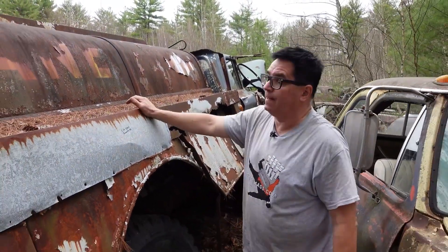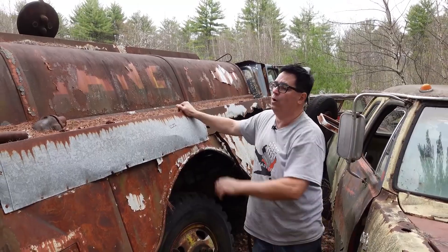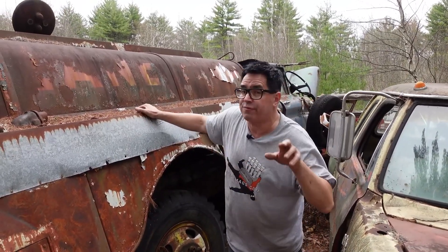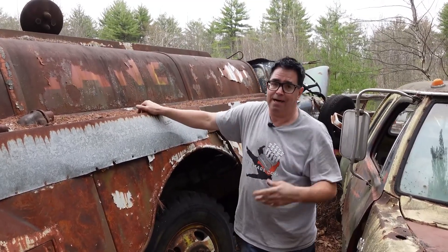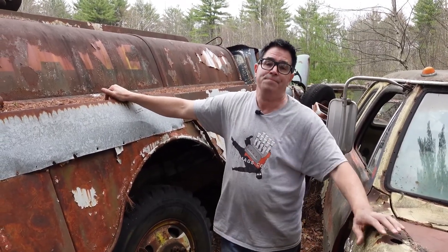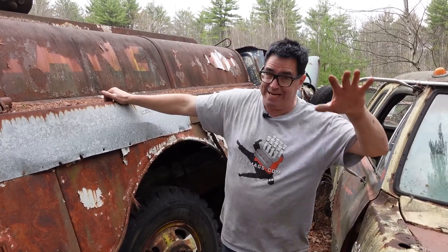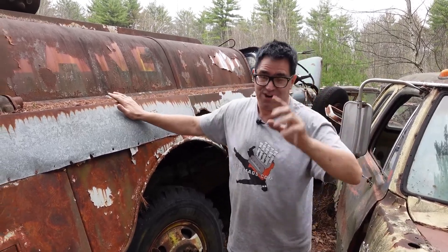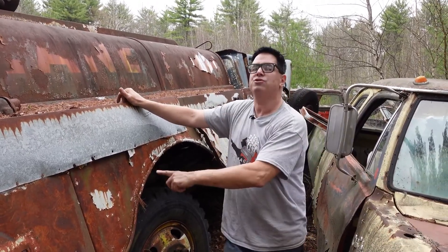Here we have it right here — the end of the line for CM Dean's 1962 torsion bar-equipped home heating oil delivery tanker truck. And if you haven't seen the first video in this two-part series, do check it out because the truck that's carrying this tanker body is very cool. It's a '62 Chevy C60 torsion bar front suspension truck, only made for a few years, replaced by the leaf springs. The torsion bar idea was they were lighter and gave a better ride, but they were easily knocked out of alignment and started eating tires, and truckers like CM Dean didn't like buying tires on the front of their rigs or the back of their rigs. Check out the first of this two-part video series if you want to see that one. And if you want to see more of these videos, subscribe to the Steve Ags YouTube channel.